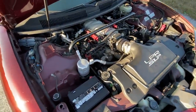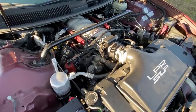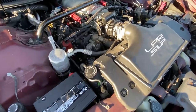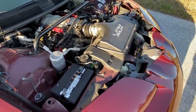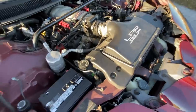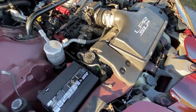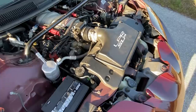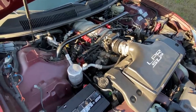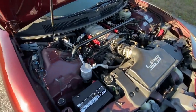I had to disconnect the cruise control because I ran the oil cooler lines through there against the frame and K-member. The motor has forged internals — never had any issues other than the rocker arm. It doesn't overheat. The first time at OSW it got up to around 230, so I was told to run distilled water with Water Wetter in the radiator, and it's never gone over 205 since. It's a stock radiator. I run an oil cooler with a fan and Valvoline VR1 20W-50 oil. Oil pressure stays around 40 most of the time.